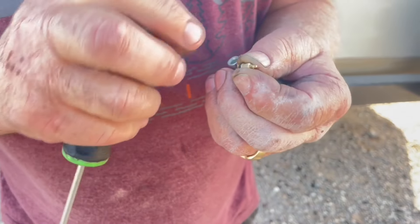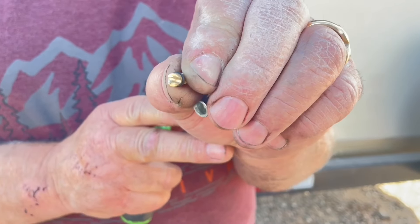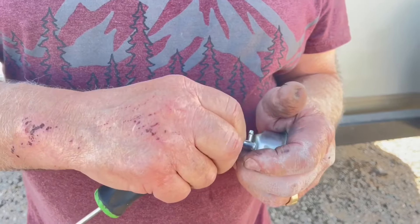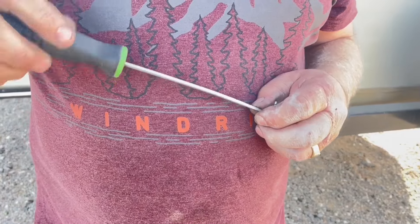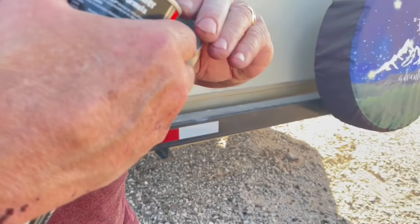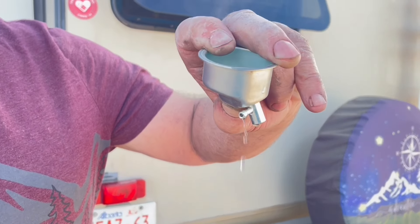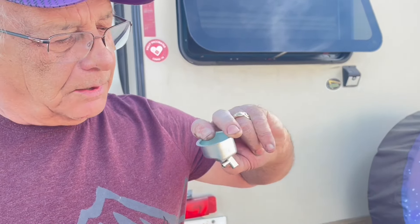That's why you only flatten two sides. The reason we're doing this is that the original screw is all stripped — you can't get it out — so we're going to put the new screw in and leave it. Put it back in and just snug it up; it's not holding head bolts so you don't need to super-tighten it. Then we'll put some brake cleaner in there and check — you'll see it'll leak out just where you want it to, where the two sides are flattened.